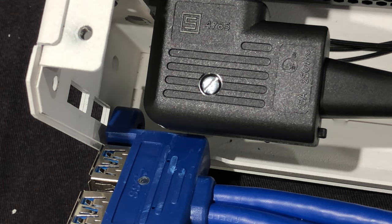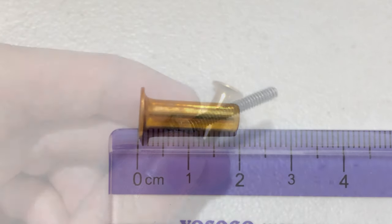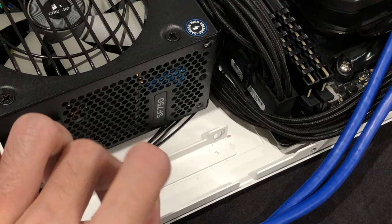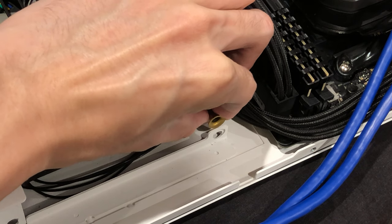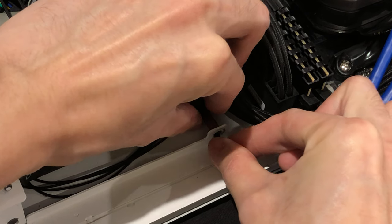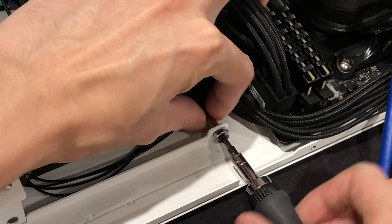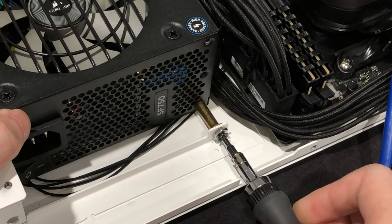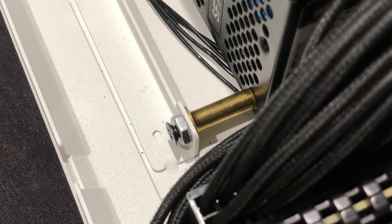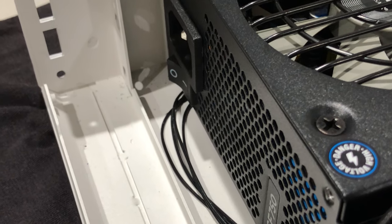However, a very simple mod can fix the problem. We can use some screw spacers and longer 6-32 screws to push down the power supply. My screws are a bit long, so I use some nuts to accommodate the extra length. And this gives me an option. The case frame also holds the PSU in place, so adding extra screws is not necessary.